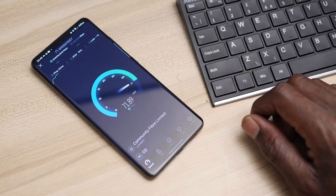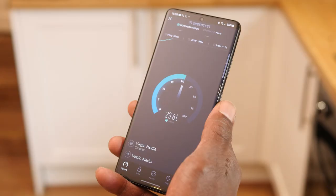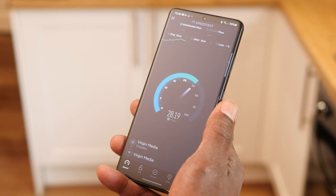If you have a very fast Wi-Fi service, then the chances are that the range of that super fast signal is not really that impressive. I found this out a while ago when I upgraded my Virgin Media router. Virgin gave me speeds of up to 350 megabits per second, and those speeds were only really achievable while standing a max of six feet away from the router — dropping off really quickly after that, to the extent that only part of the house had any coverage.